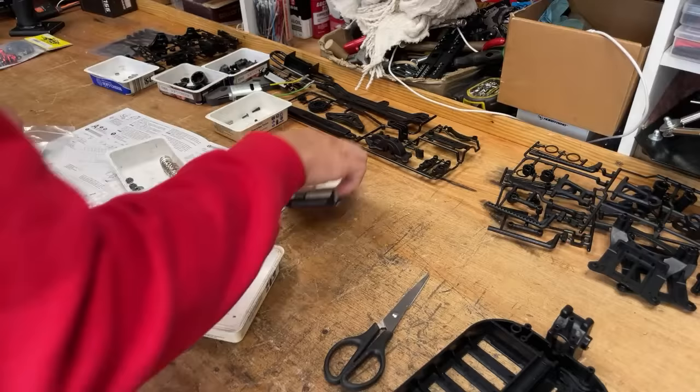That's about it. What's going on in here? Still got to do a bit of work on the old Monster. Tyres, we've got two punctures. So this one here's really gone flat now, look. I think I'm going to struggle trying to pump this up again because it's come off the bead. So we've got to try and get that back on there and then pump it up and then find a hole and plug the hole.